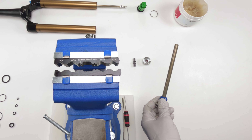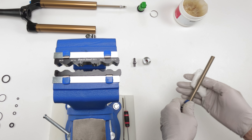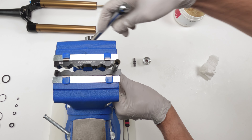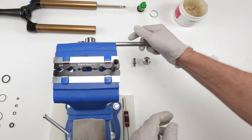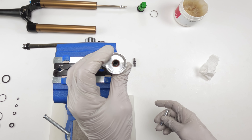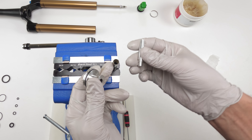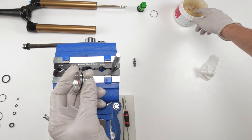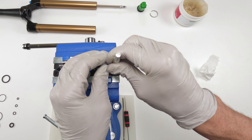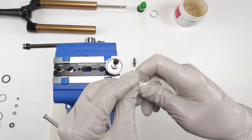Clean the shaft good with a little bit of alcohol to get any grease off. To put the seal back in — this is a quad seal with sharp edges and the metal has sharp edges — so they make this little bullet tool. Put it in there, put a little bit of grease around it, and then slide the assembly in. Now you're sure it won't damage the seal — technically you don't need it, but it ensures you're not going to do any damage. Put the bullet tool on the side. Now we want to clean and grease the threads.